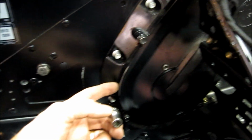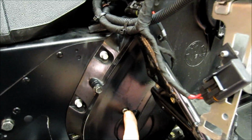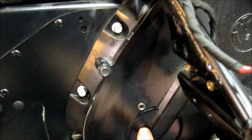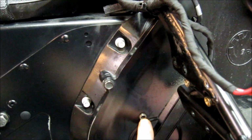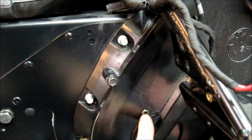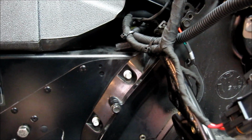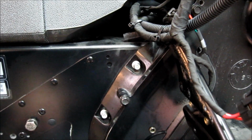and it's definitely worth taking out and cleaning once there's no oil left in here. And then this is the new 500 milliliter port right here. So when you're filling it, when it comes out of that, you know you have 500 milliliters in it. But for now, all we want to do is make sure there's a pan underneath and loosen these 7 bolts that go all the way around the chain case. There's 7 black-headed ones, and we'll loosen those up as far as they can go for the next thing.